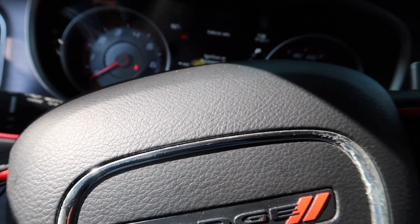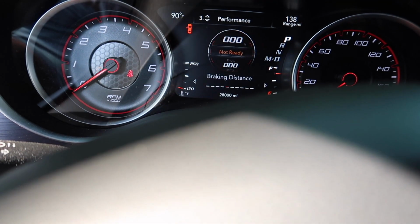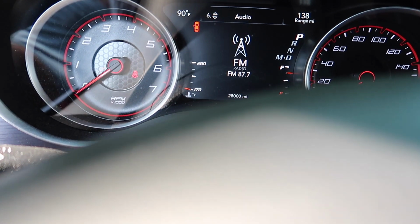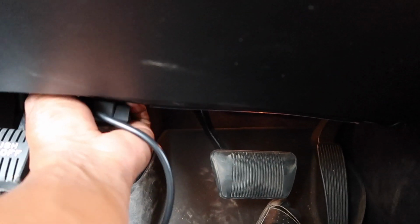Just one real quick thing, let me go ahead and say this now. If your vehicle has a tuner tied to it, make sure that you unmarry your tuner first. So unmarry the tuner and then start tuning. So I'm gonna unmarry my tuner and then I'm gonna tune. Alright, once the tuner is unmarried, go ahead and take it out. Put that right there. Then you're gonna plug this up to the OBD2 port where it was. If I can find it, there we go.